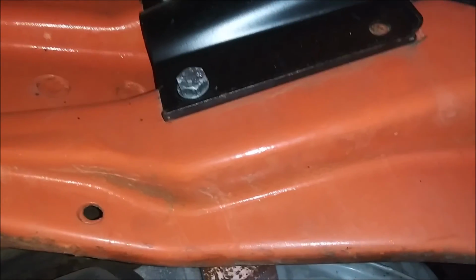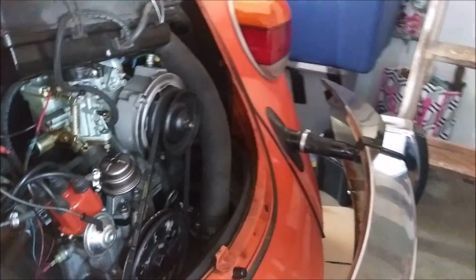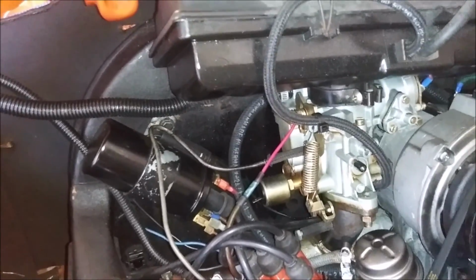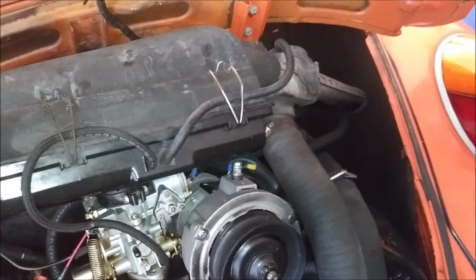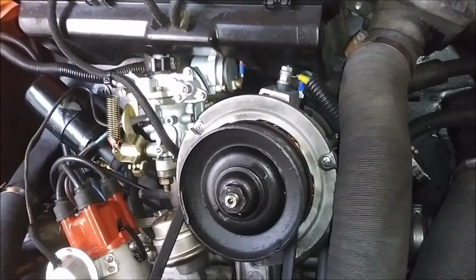But next video on this will be removing the heat risers and replacing them, so I do have to drop the engine out of this car. So next video will be engine removal. That's because we have clogged heat risers here, so this carburetor gets awfully cold. We need to replace this part, but to do that we're going to have to drop the engine, so it'll be a little bit easier to access and take apart. I won't have to remove as much stuff as if I was to just leave it in the vehicle. Or at least that's the idea. I don't know. Maybe it's easier if I just disassemble everything, but I don't think it is. So that's the game plan.